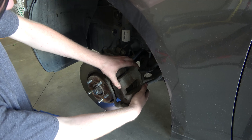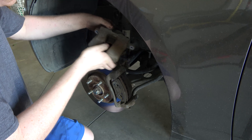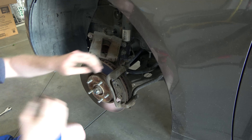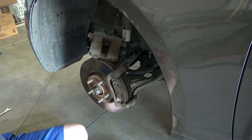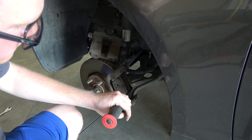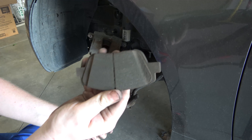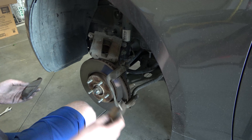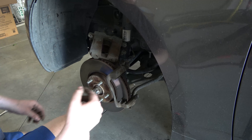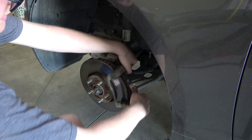Sometimes you can pull on the caliper a little bit and it will push the piston in slightly. I've just been leaving it here and not letting it hang off the hose for too long. We might need a little bit of persuasion here. Yeah, see — the pads are wearing evenly which is nice. These pins have been in good shape but I've been popping them out, wiping them off, and re-greasing them.